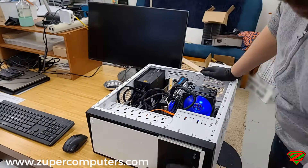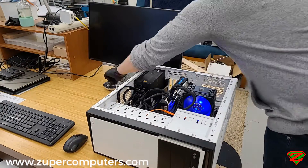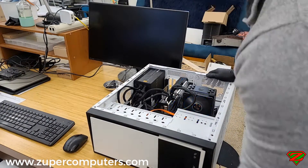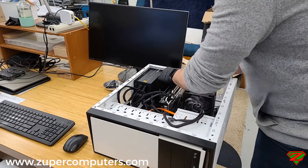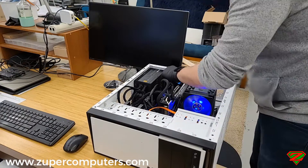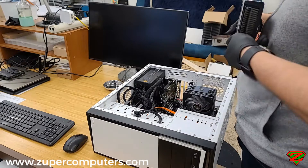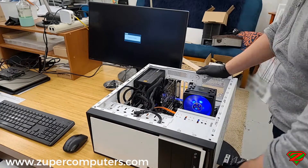This card had a dual BIOS configuration where you can start it in two different BIOSes, so I tried flipping between the two in case something was wrong with one of the onboard BIOS setups. I continued to have the same issue no matter what — whenever I tried to start the computer I just got a black screen. I also tried my graphics card in another PCI slot to see if I could get some video out, which for some reason I wasn't.